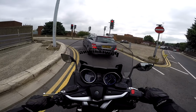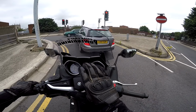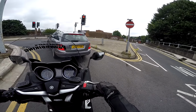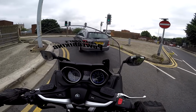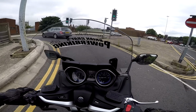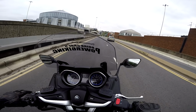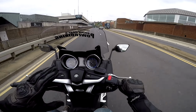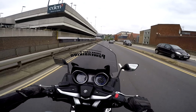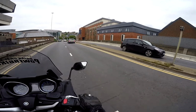It's a big old bike physically, but actually it's very lightweight, and it's nowhere near as heavy to ride as it looks, because all the weight is low down, because the engine is mounted so low down on scooters. This one though is a little bit unconventional in that most scooters have the engine mounted on, if you want to call it, the swing arm. This however has a conventional frame setup with an engine in the frame, albeit very low down, and then it's got a more motorcycle-like swing arm, so it means the handling is a bit more like a motorcycle than a scooter, which is a good thing, I think.